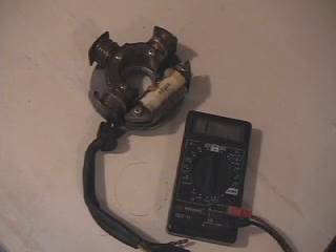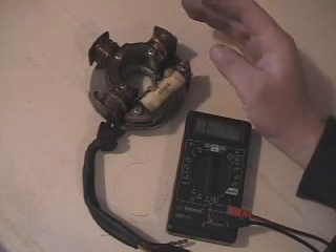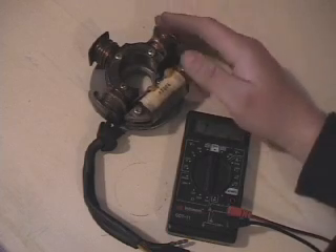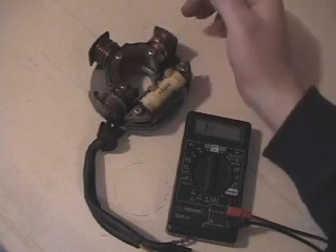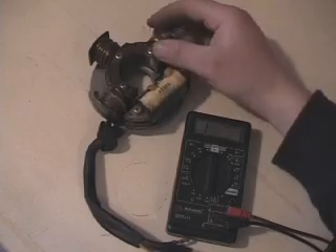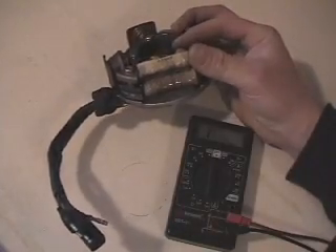This is Blaine Pertler with Pertler Electric. What I have in front of me is a 440 fan stator from the early 90s. These were used in several models — you'd have to check which ones they correlate to. Looking at the stator itself first, we've got three lighting coils, always indicated by the largest gauge wire on the stator. And then our other two coils stacked horizontally are ignition coils — the bottom one is our low-speed coil and the top is our high-speed coil.